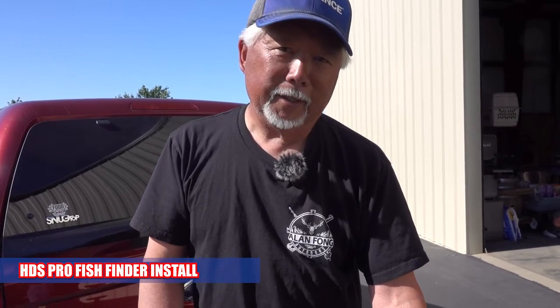So do you recommend turning it off when you're not fishing? Yes. Always try to make it a habit to turn it off. Sometimes I forget when I go home, I charge the batteries up, but it's still on. So usually the day before I go fishing, I'll unplug the charger, and by the next morning that battery will be dead. So it's best to put it on a breaker for when I'm not using it, because a lot of times I don't even turn it on, especially if I'm fishing shallow. That way it won't kill my battery.